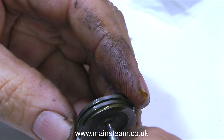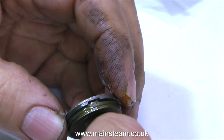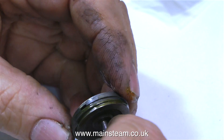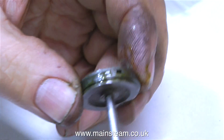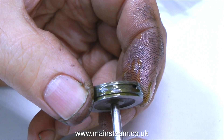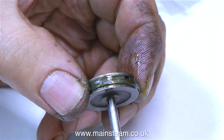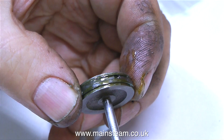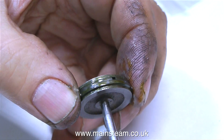Or of course the real reason is the fact that I've been doing this sort of thing for about 45 years as a hobby, so I sort of have a good feel for it. And if you watch what I'm doing at the moment, I'm very carefully fitting the piston ring — I'm laboring the point a little bit for the video, to be honest. But as you can see, I'm able to rotate the piston and the rings float in the groove, with no side slop to speak of. So this piston is ready to go into the cylinder.